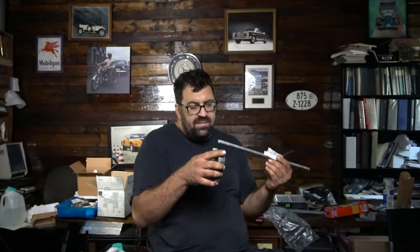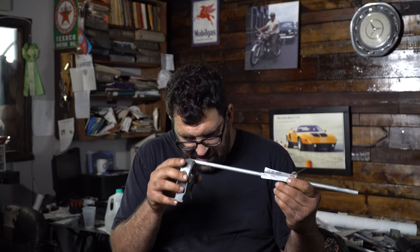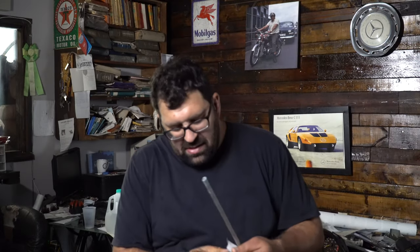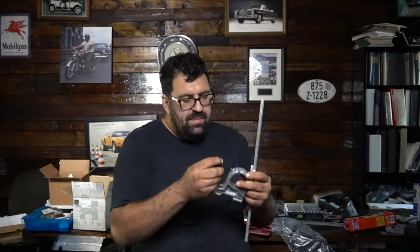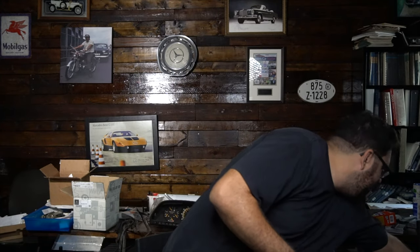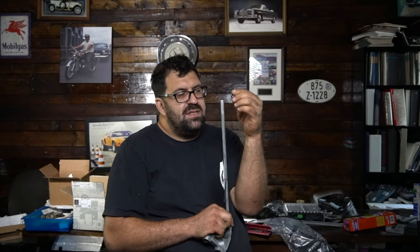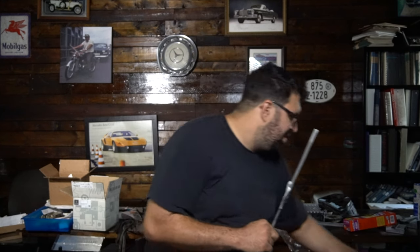In the cam journals you have a tube that is stuck in the top — literally a tube that snaps into the journal. The tube snaps into the journal using a little cam oiler delivery fitting. The tube slides in the end, and then you have these — there are actually two sizes to this — and they slide over the tube. This is a late tube and an early oiler, but you get the gist.